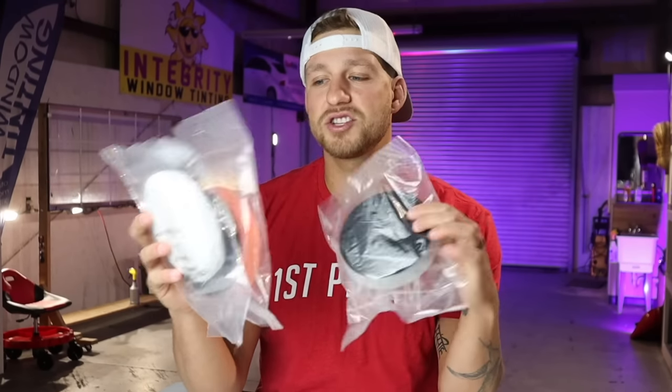You also can get 6-inch. I typically like the 5-inch and the 6-inch options when it comes to foam pads. If you have a heavy oxidized boat, you are always going to use a heavy cut compound on the rotary machine with a wool pad to cut out the oxidation or sanding marks if you had to sand. Then the next step in line is going to be finishing out the boat.